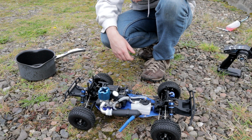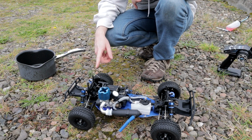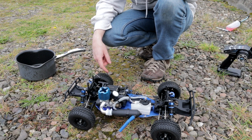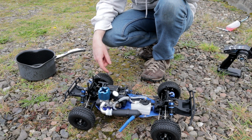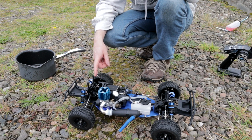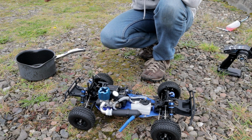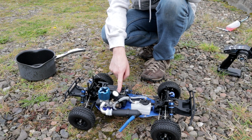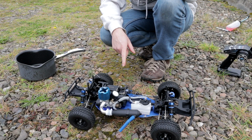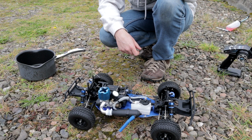So now on to the bit where you run it around at very low, maybe quarter throttle. Alan said to do 2 tanks of this. So we'll see how long it takes me. Just very light throttle, just moving, circling around. Enough for the clutch to engage, but fast enough that the clutch doesn't overheat and melt the spur. So, let's just crack on with it.